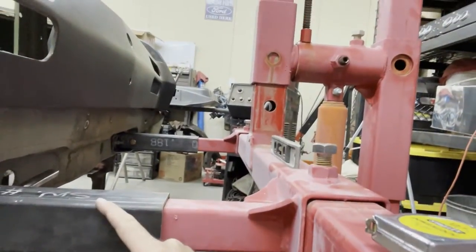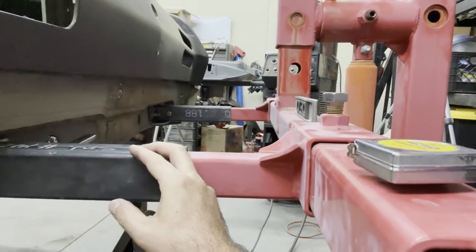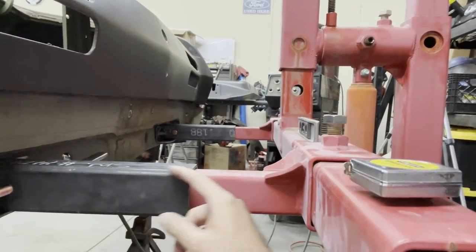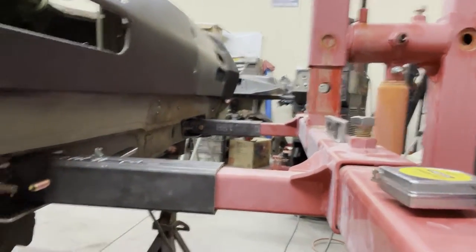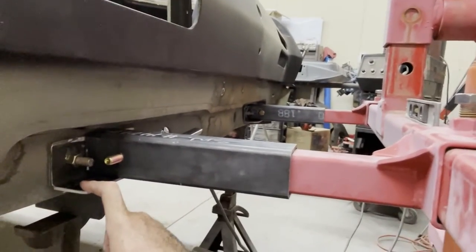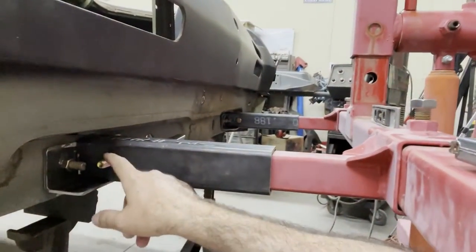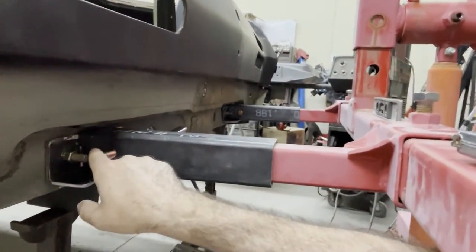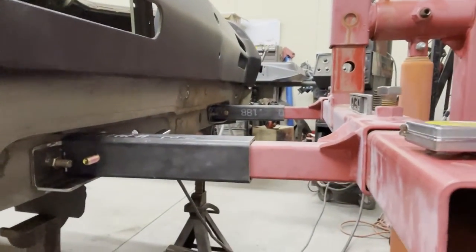So what I did — this is actually two-and-a-half inch square tube, and it's a pretty thick wall. I just took one piece and cut it on opposite corners to make two L-brackets. Then I simply bolted them to the rear bumper bracket mounting locations using grade eight hardware. Just drill the hole in it, slide this in, and then run the bolt through to retain it to the beam there.